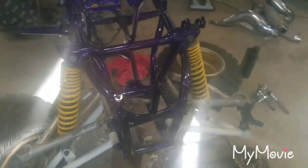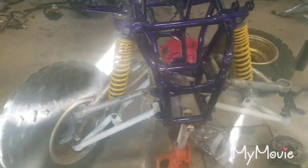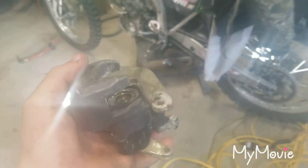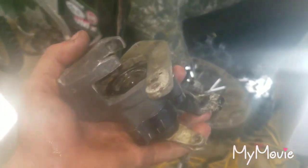Got that top bar over there for the A-arm — top A-arm — so everything's solid there, everything's tightened down in the front. I am putting the rotors on and calipers at the moment. I took out that piston in there and cleaned it up. The piston needs to be replaced but as of now this will do.